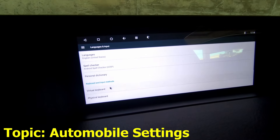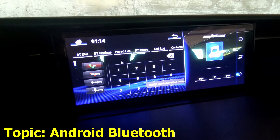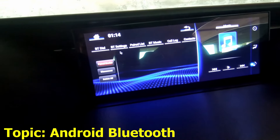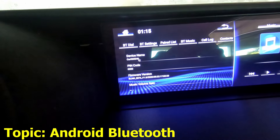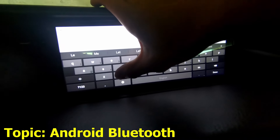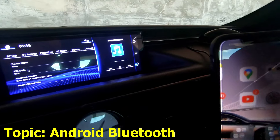Let's connect the Bluetooth. You need to go to all apps and it will be there. It says 'Connect' — I need to connect it still. I'm going to ensure my Bluetooth is on — yes, my Bluetooth is on. Now I'm going to go to Bluetooth settings, making sure everything's okay. My device name is Car Kit 0246 — I could keep it like that, but I'm going to change it. I'll type 'Lexus', keep it simple, then done. Now the name is known as Lexus. Now I'm going to go to my Bluetooth and try to connect.